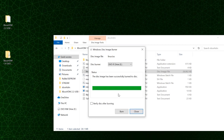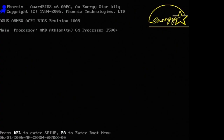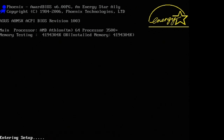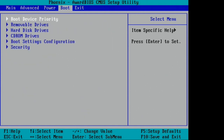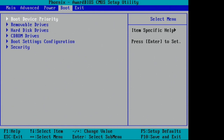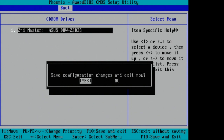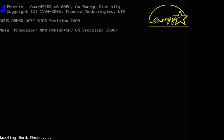Once done, click close and put the disk into the older computer with built-in IDE. Press Delete to enter the BIOS. We'll need to set the DVD drive to boot first — under boot device priority, CD-ROM is selected to boot first. Verify under CD-ROM drives that the correct drive is number one. Press F10 and save. My new hard drive is already connected to this machine.